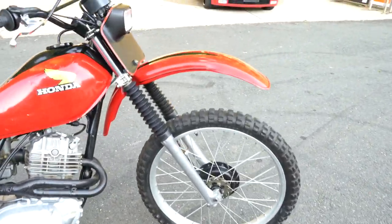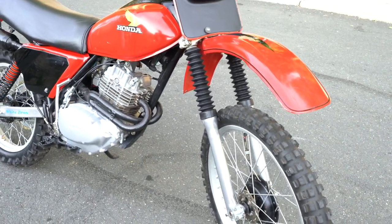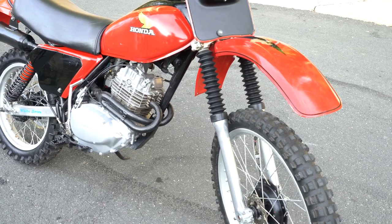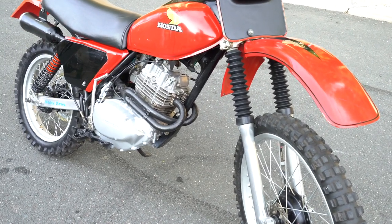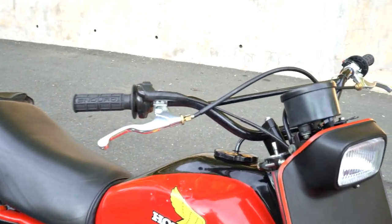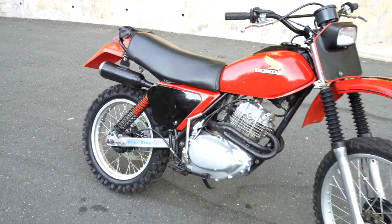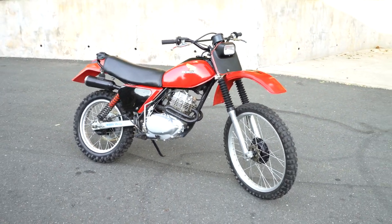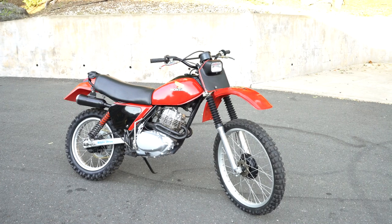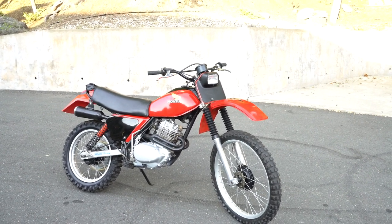The exhaust muffler was painted the high temp. The Supertrap muffler was repainted the high temp black. The handlebars were cleaned up and touched up painted. The seat was reconditioned, and pretty much full rotisserie detail. You could think of doing a full 10 hours in the detail shop, painting and cleaning and polishing from top to bottom. The service department did a compression test, 155 PSI, which is factory spec.